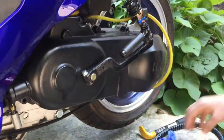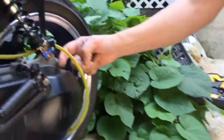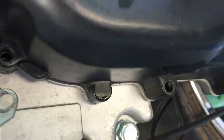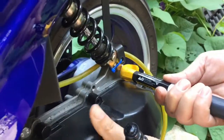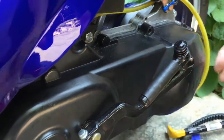If it's the first time taking off your belt, you're probably going to have to use some kind of pry bar. There is a little tab right here that you can pry on, and there are alignment dowels here and down here that hold the case in place. So I'm going to take my pry bar, put it up on that tab, and gently pull. This one's coming off very easy because it's been off before.